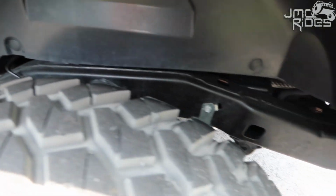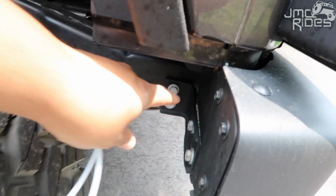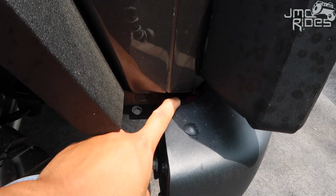There's holes all over the frame. You got some right over here, and another small one that I can see. You can pretty much just follow the frame. You have the same holes on both sides of the frame. On the front of the vehicle, you even have access to a couple more holes for the frame too. Just spray everything using the little hose attached to that can. And like I said, any rust you already have, it's gonna stop it from getting any worse. And for you guys who don't have any rust, it's gonna stop any rust from even starting.